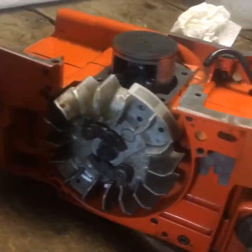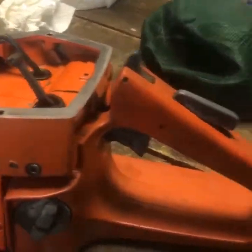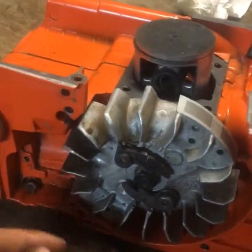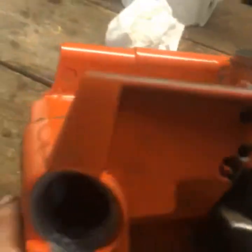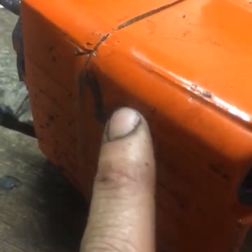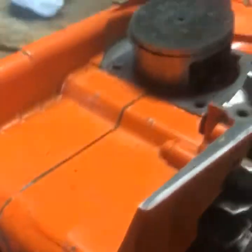This is how far I am on this 272 XP. I've got it stripped down as much as I'm gonna strip it. I took all the starter stuff out — it was just literally packed with crap, so I took it out just for cleaning. I cleaned out my oil tank. There's a screw that goes there that appears to be missing — it leaks oil — so I'm just gonna find a screw that fits. She's shiny now.